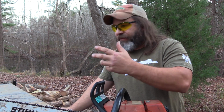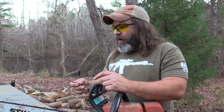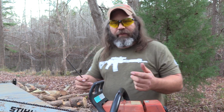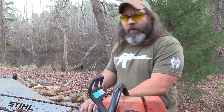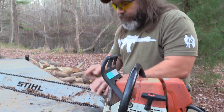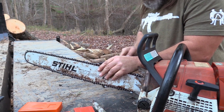This side is actually not too bad, but as you're running your saw, you run a day or half a day, even if you haven't stuck it into dirt or anything stupid, if you've got a minute, it doesn't hurt to dress the teeth. Run what I call a maintenance sharp. Like, hey, I've got a few minutes, we're waiting on the skidder or waiting on the roach coach to bring you your food. Then just take a few minutes, 3 or 4 strokes. Like this side here is in pretty good shape.